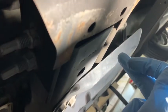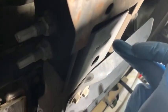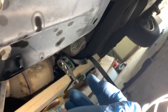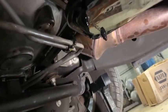And I tried to pull the bolts out of the cross member here and jack up, but guess what? There's something above this bracket that has a top on it to where you can't push it up unless you unbolt where it bolts below the transfer case here. So you can't jack the transmission up. You could leave this in place, unbolt it, and jack the transmission up, but that's a pain to get to. So it's got a flexible thing there on the exhaust. So it flexes a little bit. Now really you just kind of have to flex, put the upper side up here in a bind, which I don't like, but I really didn't have a choice.